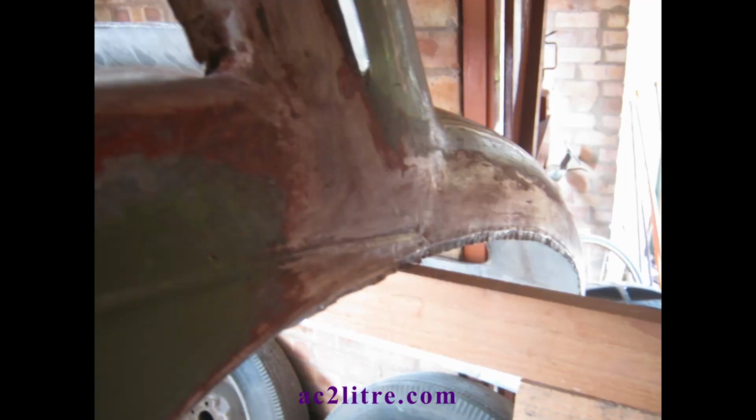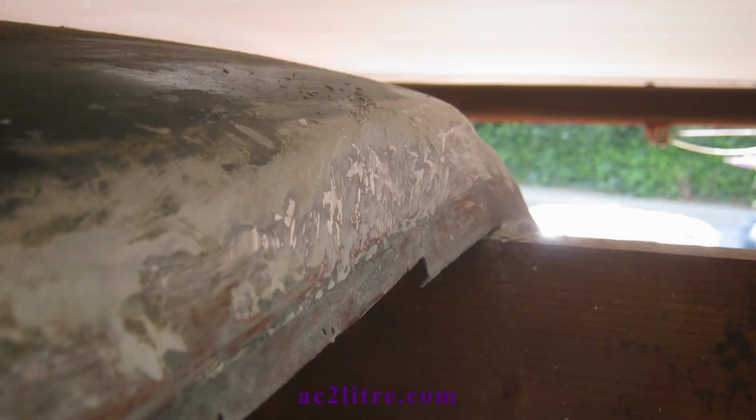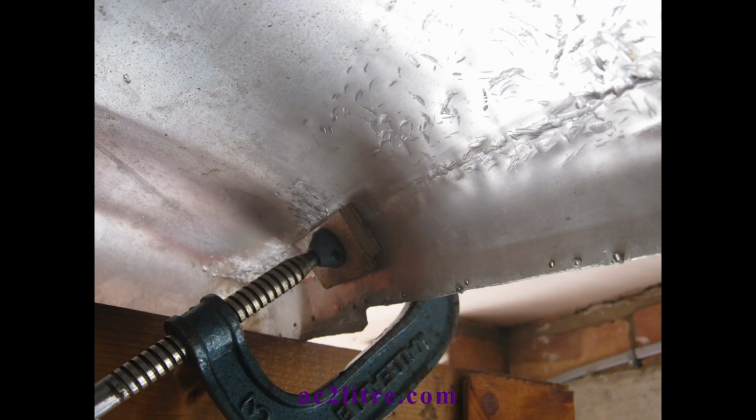They were expensive. They also had to be applied to the back of the panel where I would not be able to see them. So I used soap, which needs to be a simple soap with nothing fancy added to it, and it worked easily using my trusty little butane torch. I was able to do some panel beating along the edge of the roof, which I had easy access to with no wood frame in the way.